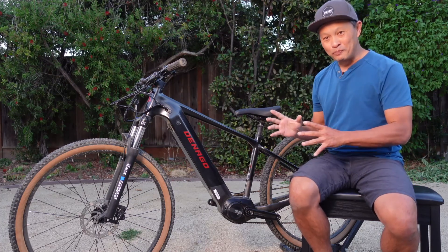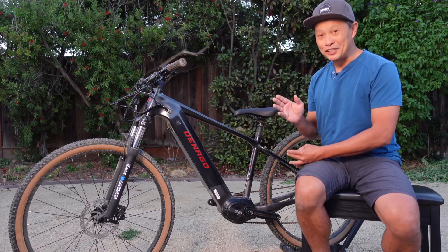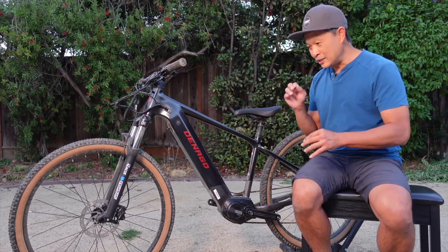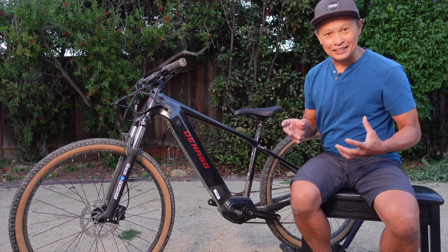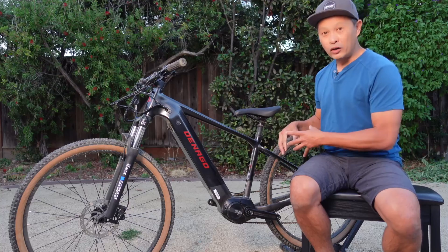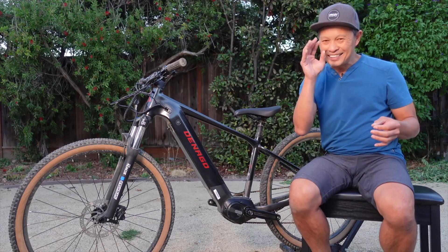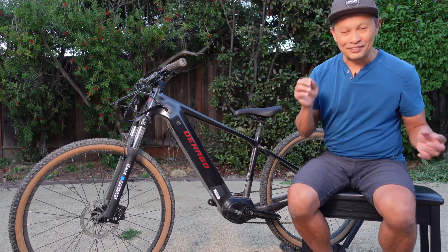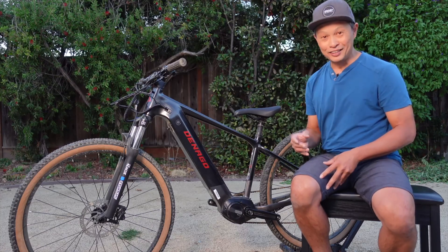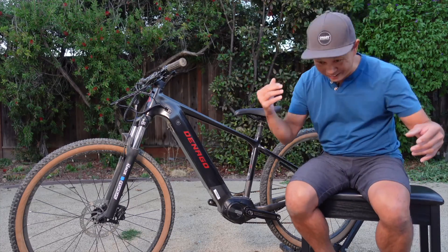The crucial problem I encountered when testing this bike and motor is the momentary shutoff during shifting. These motors detect chain tension when you're shifting and cut off power briefly so you don't crunch the gears — it's good for beginners. It's pretty hard to power through especially in turbo mode at 95 newton meters on a gear change. Bosch does this too, but they've done it for so long that you can hardly detect it. Bafang does the same thing to protect the drivetrain, but they do it too much.